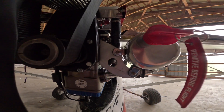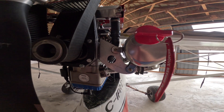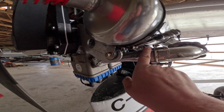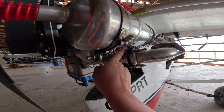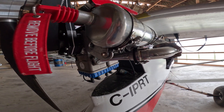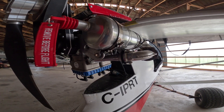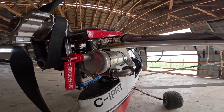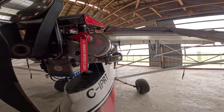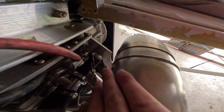The new clamps have two mounting points, which prevents the exhaust from drooping and laying right on the clamp. What was happening before is it was wearing a hole in the bottom of the exhaust. Now it doesn't budge — I've got minimal clearance away from the wing, and that's only with the two front ones installed. I don't even have the back one in yet.